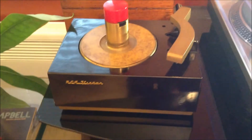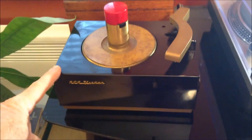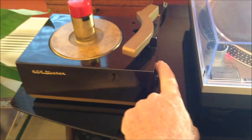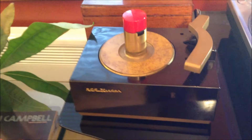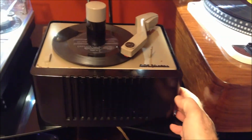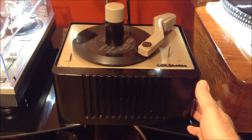Another little thing I have here is one of the 45 players — everybody's seen these. This comes in two models; this is just the deck version, which plugs in through a preamp the same way a regular record player works, but it just works for 45s. It has a volume control which is just a pad, so it's best to bypass that, use just the switch, and put in a modern cartridge. I have another one in the other room with the amplifier built in — so you can rock around the clock with the 45s. I've put a modern pickup in it.